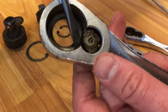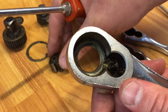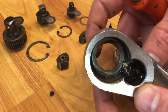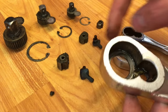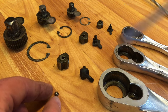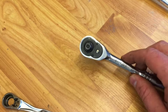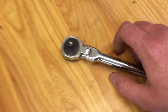Once you get that out, you can take a screwdriver and pop out the gear. Pull out this little tab. We've got all three disassembled — watch out for a little bearing in the bottom; it can fall out. This style here is going to work the same way, but you're going to remove those six-point bolts. Once you remove those, you can just pull it all out the same as these.